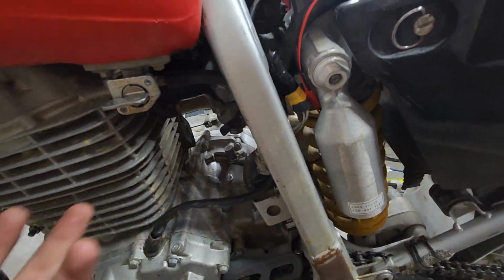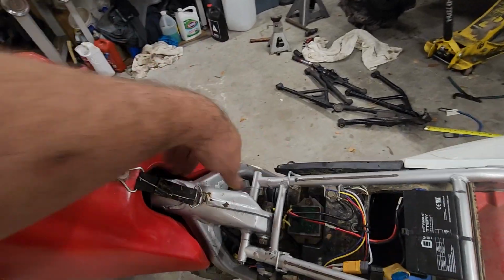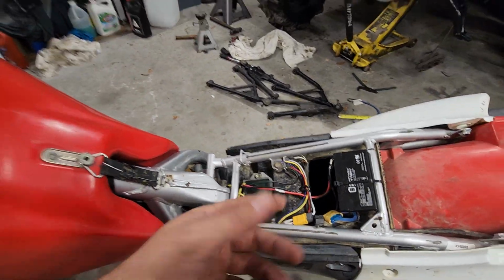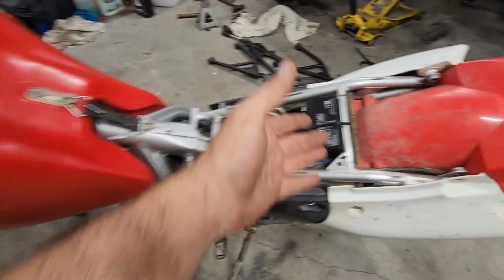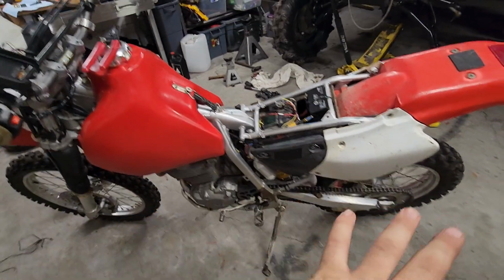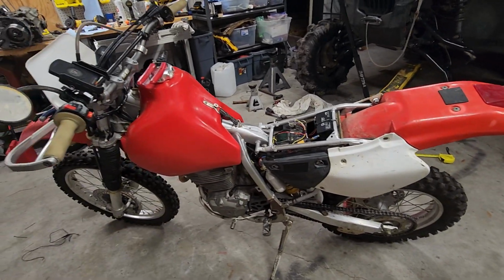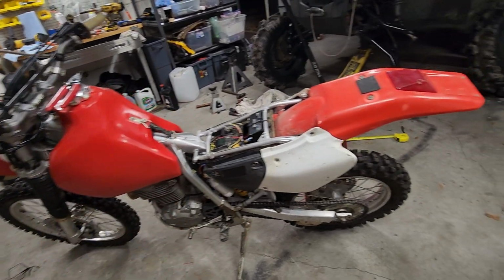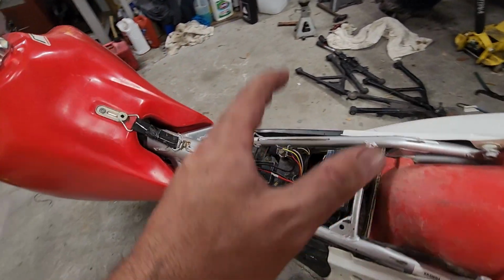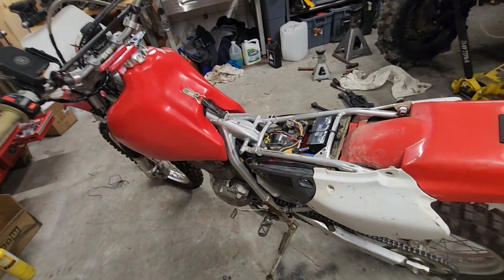The factory wiring is all the same except for the stuff I removed from the factory rectifier. There's no rectifier under here anymore, there's just this one. That factory one was just running the headlights. These are some higher wattage headlights. So, and you got turn signals and stuff, and a phone charger, and a battery, so you need a better voltage regulator than the factory one. So I took those few wires out, but the factory is like stock, and I'll put up a picture of the factory wiring diagram, or you can just Google it, XR400R wiring diagram. They're all over the place. It's a super simple wiring diagram. Yeah, I don't feel like doing any editing, so why don't you just Google that? I'll put a link in the description.